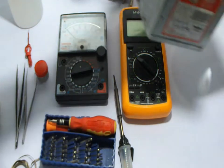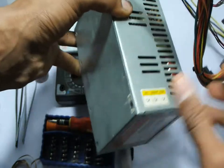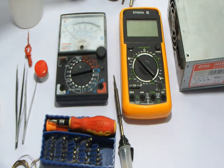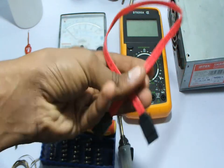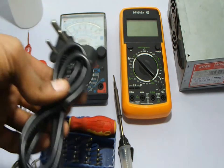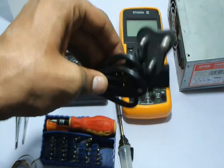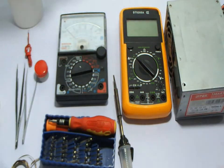We also recommend you buy an additional power supply for testing purposes. This is the additional power supply we always carry with us. Also, this is a SATA cable — for repairing and testing purposes, you need it a lot. Sometimes the customer's SATA cable is faulty and that's the cause of the problem. Power supply cables can also be the issue. These three things — the SATA cable, power supply cables, and additional power supply — are for testing purposes.